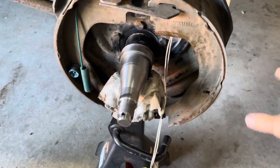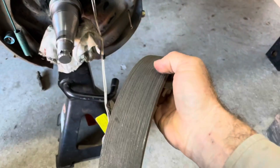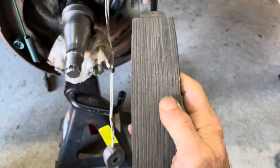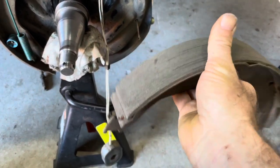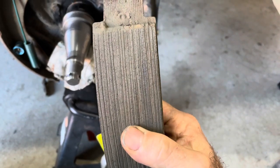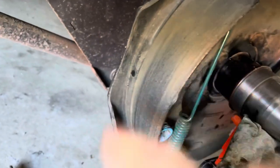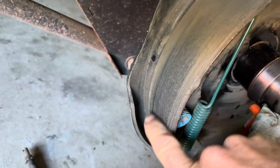What happens to your brake shoes after driving about 2,000 kilometres of dirt roads is the shoe starts to groove up due to the dust running over it, and that stops the shoe from gripping whatsoever — there's just no surface area. You can see it's not even shiny anymore. Looking at the front shoe, this is the only part that's doing any braking at all.